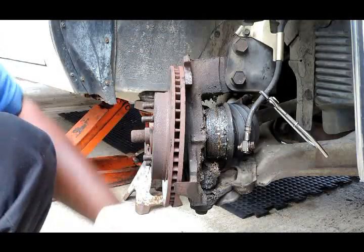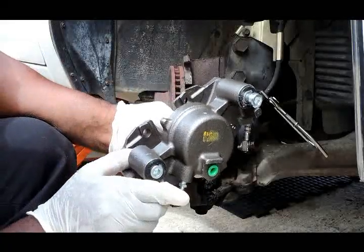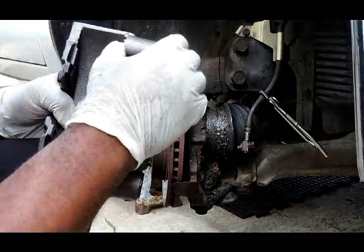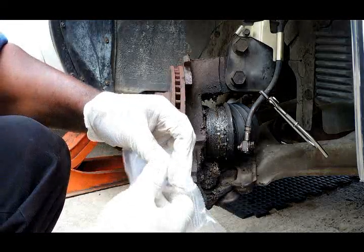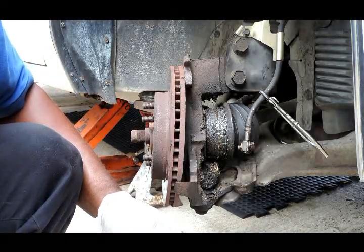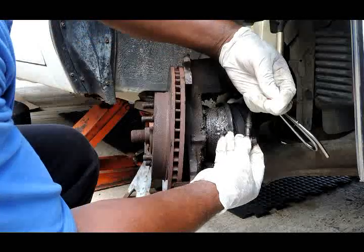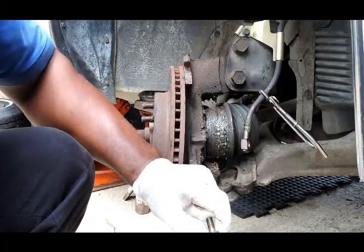Okay, here we are on the right side. We got the brand new caliper, new sliders, new bolt. Yeah, that's good. Sliders slide back and forth. That's great. We also have two new washers slash gaskets. So let's get those installed on the bolt. Remember, one goes on each side of that brake line.